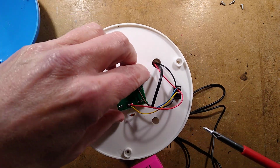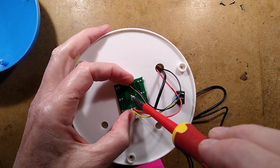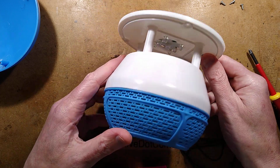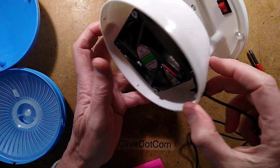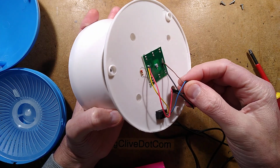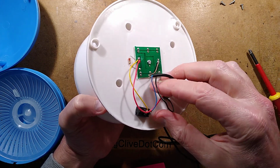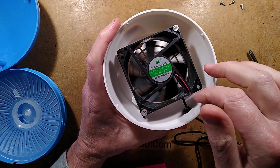Okay. Oh, I know why they've got those holes there. So it can actually go round any way round, because there's only one screw hole. That's quite neat. Maybe there's a version that does have 8 LEDs. Anything else worth looking at? So the supply cable comes in here. It ducks up inside this pillar, comes up here. It's this brown and blue wire. The blue goes to the switch and gets switched. Then it powers the LEDs, and then the red and black for the fan go down there again and to the fan. That's just the ones that are attached to this.